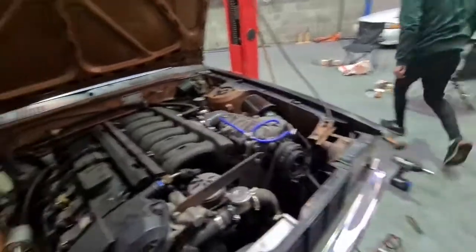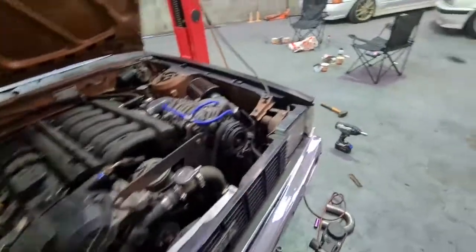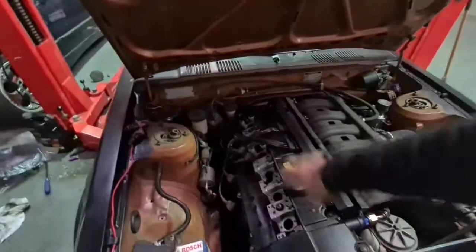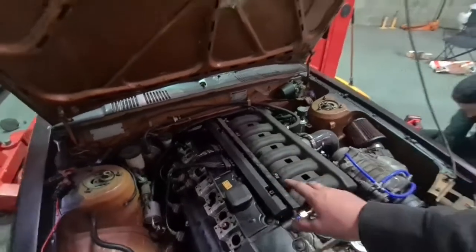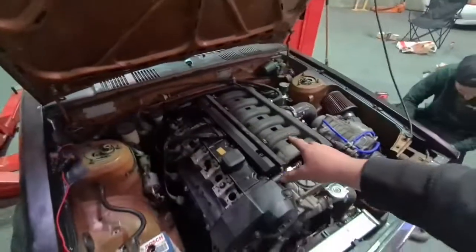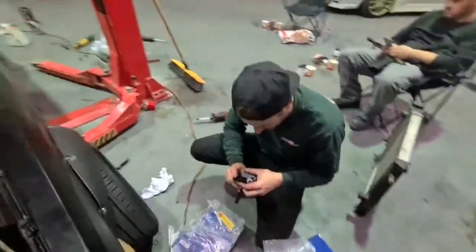We've got some new injectors, new spark plugs, and a smaller pulley to put on. And new coil packs. Yeah, everything. There's actually a lot of stuff to be done and not enough time. New coil packs, brand new. This thing is getting a birthday, big time. So, just did all the gasket glue, everything. Resealed the rocker cover. Just put B25 injectors in, swapped them out. We did have B28, but they're a little bit too big and overfilling it. So, smaller injectors, and now obviously new spark plugs, and we're gonna put the new coil packs in. And this thing should run like a dream.